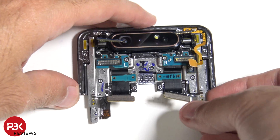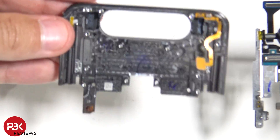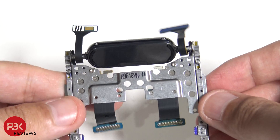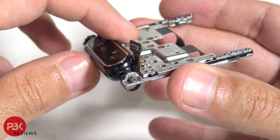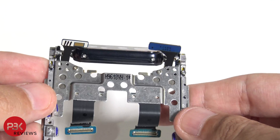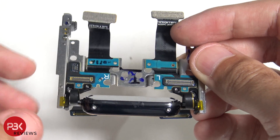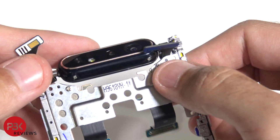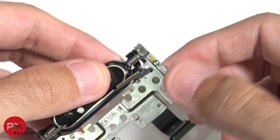Now finally we can remove this from the housing. Here you can see the small gear working on the side like a small little factory. You've got two more screws on this side and two on this side to remove to actually get access to the cameras themselves. And if you actually want to remove this mechanism over here, you also have two screws to remove over here to get this whole portion separated from the metal part.